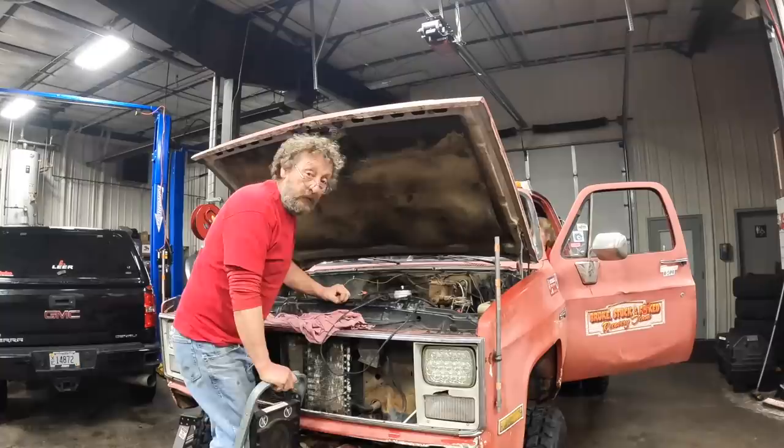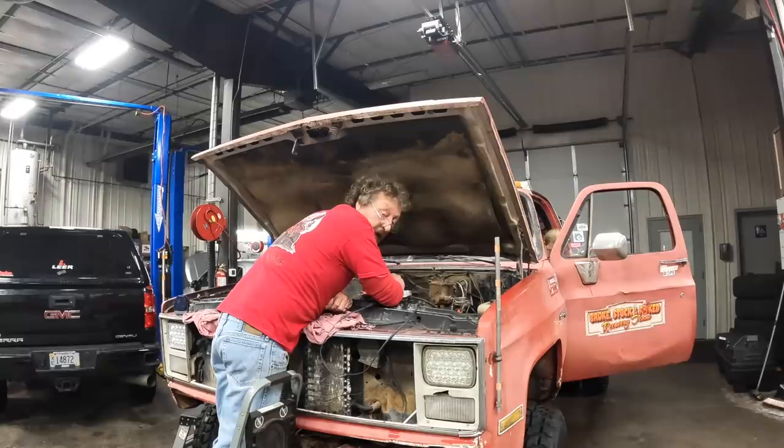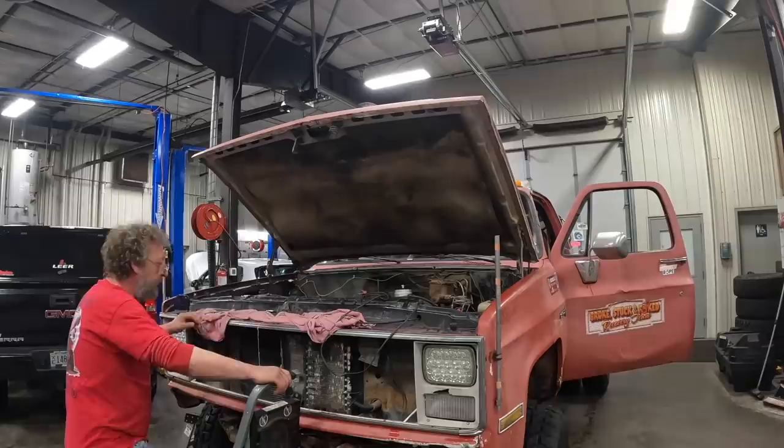All right, now we'll recheck. Go ahead and start it up. That's about 18. We must have bumped the distributor while we were tightening it up. Time to try again. Shut off. Okay, I think we got it this time. Start it up.